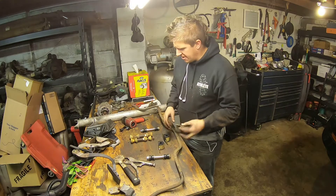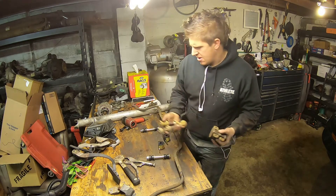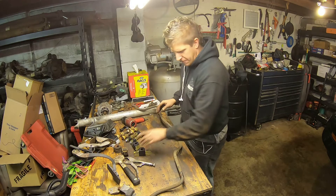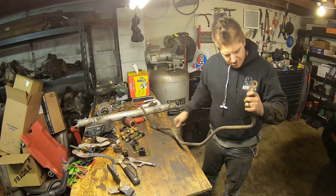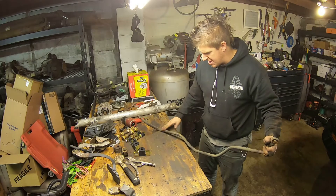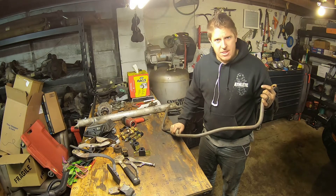So far smooth sailing. We've got the original sway bar bushings and end links out on the rear, and we've got our new ones here — bushings and links. Before I put this back in, I'm going to go through and clean off the corrosion where the old bushings rub, using a buffing wheel on both ends. And then just wipe the whole bar off and make sure I don't see any cracks or damage or anything like that. And then we'll go ahead and get it put back up in there.